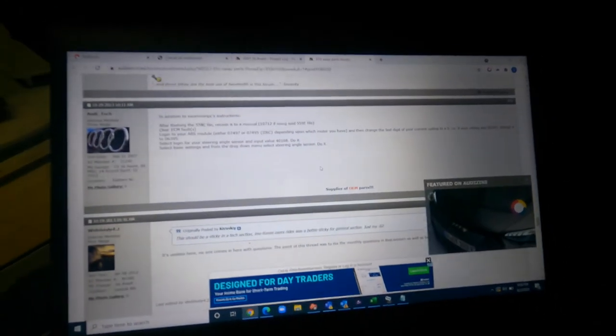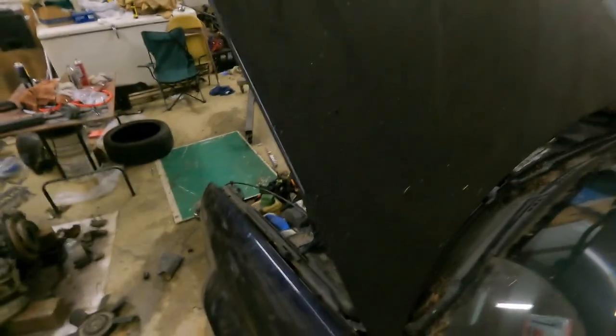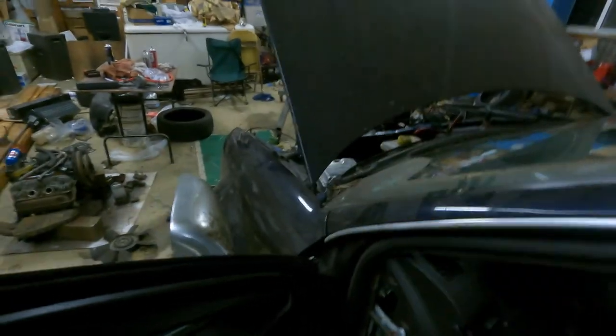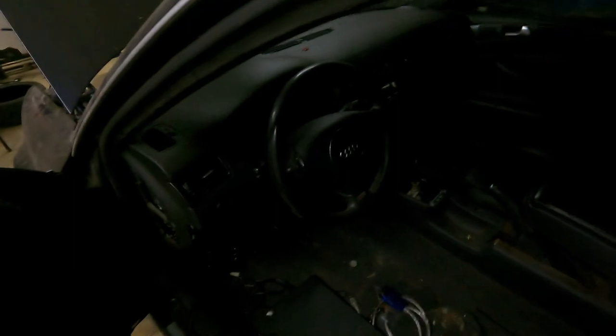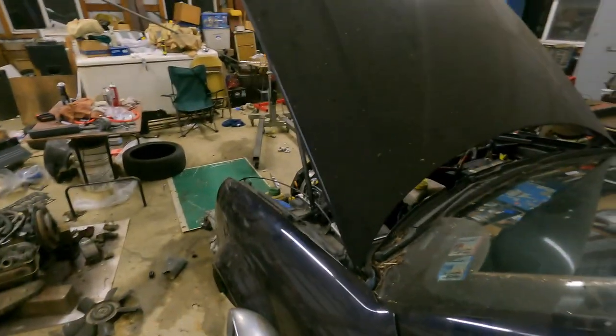Now that the car is coded to manual, there are a few other things you'll need to do to have the car start again. The ECU is now fully a manual ECU — you've completely coded it. We're going to have to run the wire from the switch on the clutch up to the ECU. I'm going to show you that in the next video. If this was helpful, drop a comment — I'd be happy to answer any additional questions. Stay tuned, we are already getting to work on getting this thing back together and I cannot wait to take it on the road.